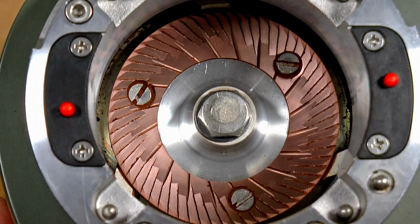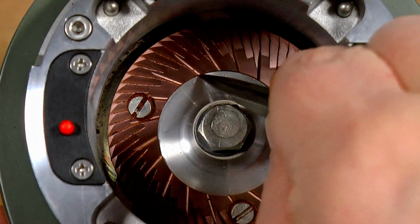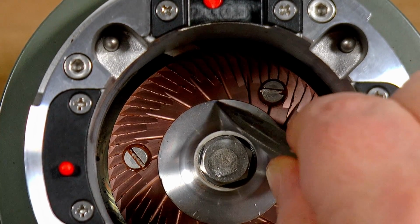The bottom of the grind chamber, the lower carrier surface here, is a bit high in relation to the burrs. I think that probably accounts for it. So if Turkish coffee is important to you, you might want to think twice.